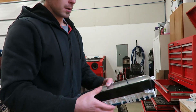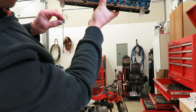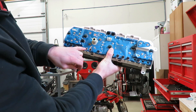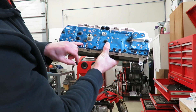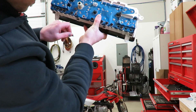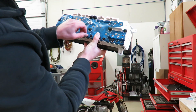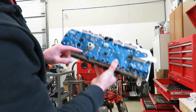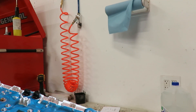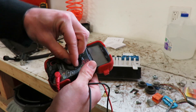To find out which bulb you want, just pull these out, pull the bulb itself out, and you can look through it. Hold it up to a light and you can see what the bulb says or what the cover says. So there's 'back door,' there's 'DF,' and 'overdrive off' - that's for auto. You can really just pick any of those bulbs that aren't being used.